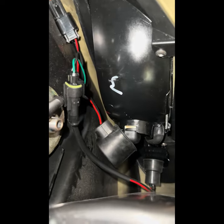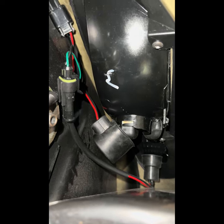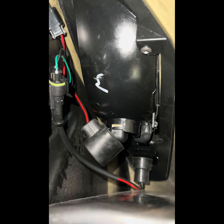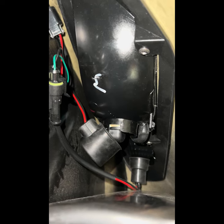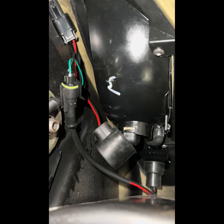Going straight in to show you where the headlights are — I've already unseated the rubber cover that protects it from dirt and water, so that's why you see it sitting like that. Normally yours will be covering it. That's the headlight right there. It's really accessible — you twist it to the right and it pops right out. The black and red cord underneath is extremely long, so it's easy to pull it toward you to work on.